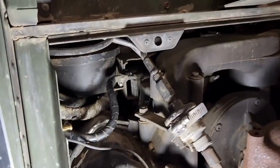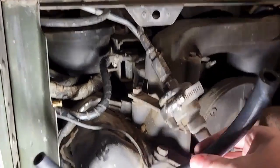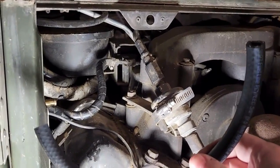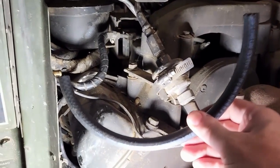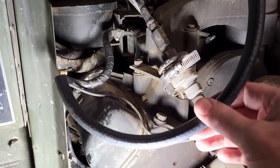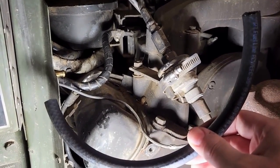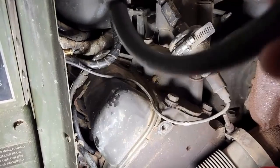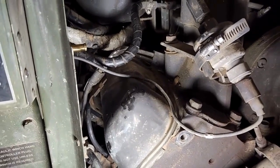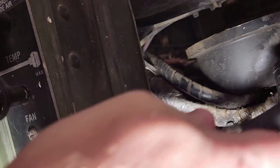So I got a new fuel line. I went to O'Reilly — O'Reilly sells them by the foot. I tried AutoZone and they didn't sell any. O'Reilly had the hose I was looking for. I bought one foot of it. The parts manual says I need 10 inches for it, so I got this new line. I'm gonna cut probably two inches off of it to make it fit a little better inside here, grab a couple of new clamps, and put it back on. Hopefully with these two fixes that clears up my fuel leak, and we'll be able to start the truck. Hose connection number one is right here — let's get it pushed on.